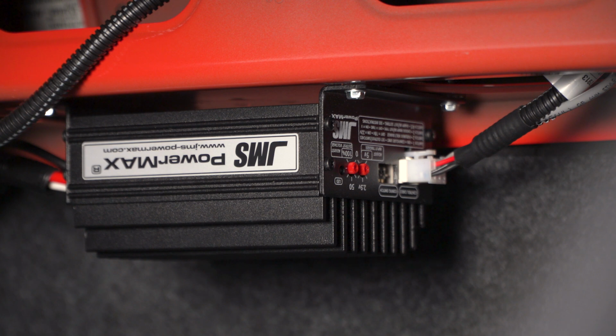When we hit the ignition button, then the green LED should illuminate on. It's gonna stay solid. That's how you know that everything's functioning correctly. Another thing that you're gonna wanna test is you're gonna wanna make sure the green LED will slowly blink, and that means that the unit is boosting the voltage. So a way to do this is to turn the ignition on and then press the accelerator all the way to the floor. Since the fuel pump voltage booster works off the accelerator pedal, and that's how it knows how much to boost.